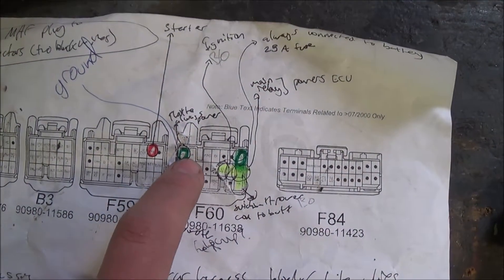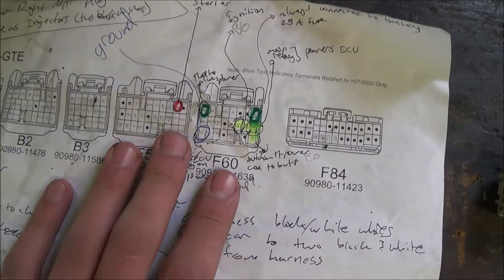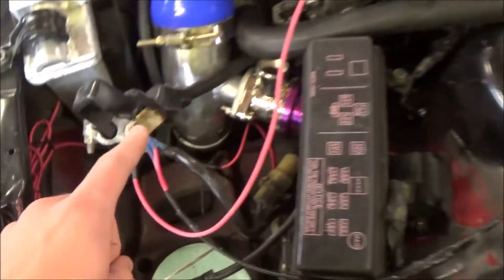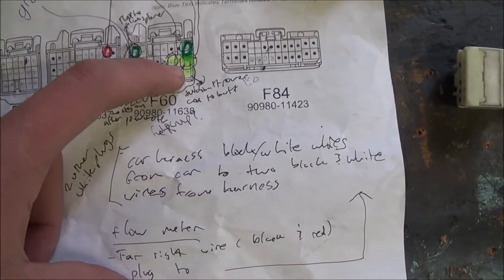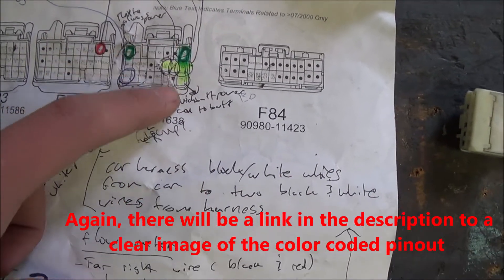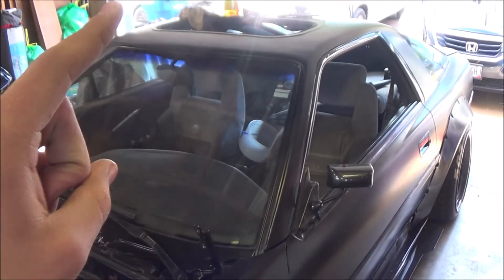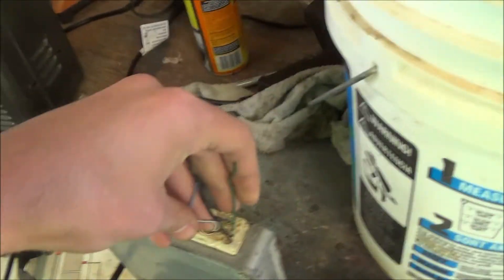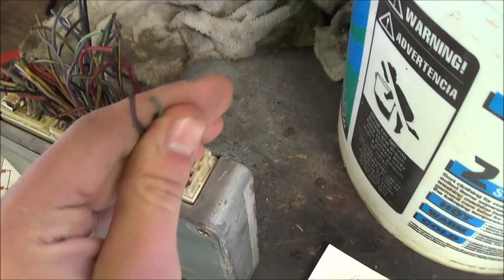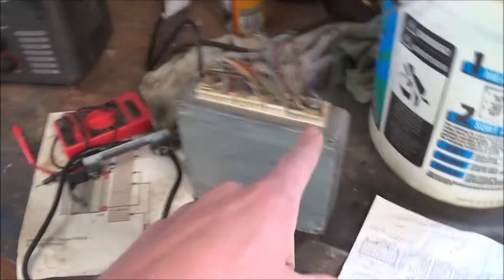With that, you'll need to do constant power for this one right here — this is the power for the ECU — and this one right here, which is the power for the throttle. There's one more that I'll show you later, but it's not on the ECU. These two wires are just run straight to the positive terminal. Now, for the highlighted ones — the ones that are on in the on position — I have four wires that all come off that on switch. When the key's in the on position, that wire we talked about sends power. You just take those wires, splice them all together, bunch them up, and if you have them all connected to that one wire going back to when the key is on, that's how those ones get power.